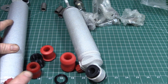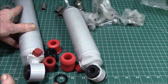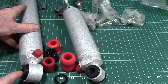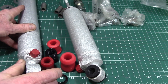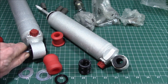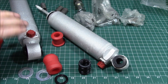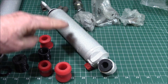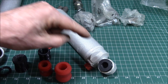This is basically retrofitting Rancho 9000s with bushings to match the Mazda shock mounts — so these are the new Rancho shocks but retrofitted to match the Mazda shock mounts, like the original Rancho shocks that used to come with the right bushings. We're going to try these out on his Mazda B2600 pickup and see if they work — we might have to tweak the dimensions a little bit.